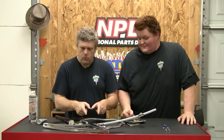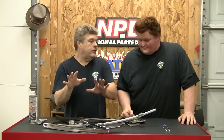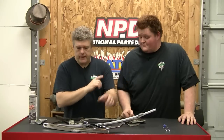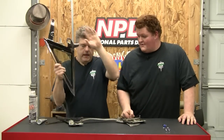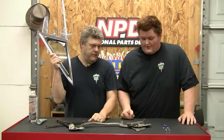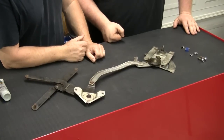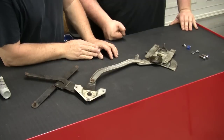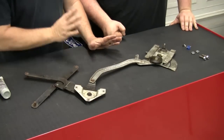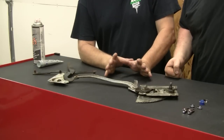What I'm going to do now is pull this out of the way and talk about what else we've got here on the table. Your window regulator — now I know you thought we'd want to replace this, but we're not replacing it. The reason is: most of the time on the Mustang, especially the passenger glass is in decent shape because it's never really used that much. It's not rolled up and down nearly as much as the driver's glass.